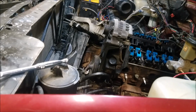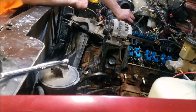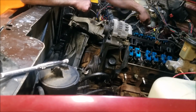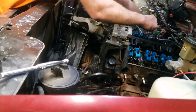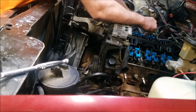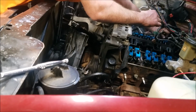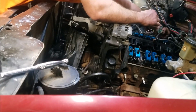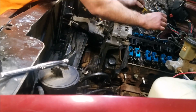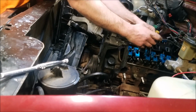Actually, while I'm at it, I can go ahead and pull off all the rocker arms before I head to town. Inside these poly locks, as they call them, there's a set screw inside a long skinny nut with a hex head on top. They use that long skinny nut to reach down past the rocker arm body.